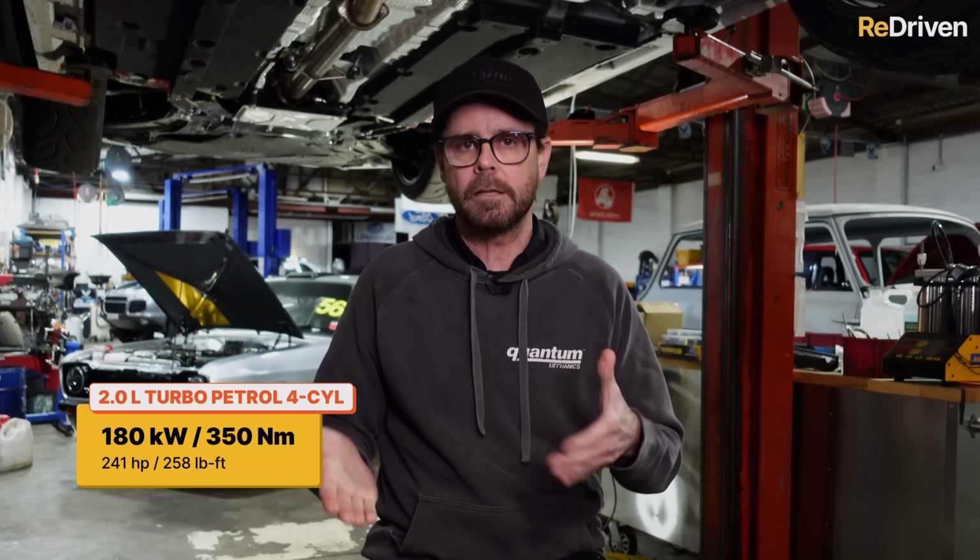Look, this is part of Toyota's new-ish generations of engines. They are more complex than older engines, so it's possible in the future they might have some issues, but so far they are proving to be pretty reliable. They are turboed, so there is more to go wrong, and I would say they're probably less tolerant of being neglected like some other Toyota engines. So my pro tip here is just keep on top of the services, do it every 10,000 kilometres without fail.